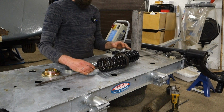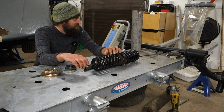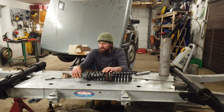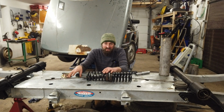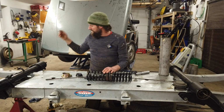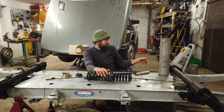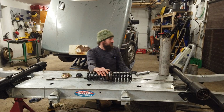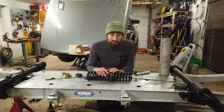I really like it. And the first time I saw it, I got a bit scared about these push rods because they are rather thin and they are suspending the entire car. Of course, only one wheel at a time, but anyway, if one of these snaps, the car will just collapse on that side completely. It will just swing the axle up. In the front it got an emergency stop. It doesn't do that in the back. So in the back it will just be able to swing all the way up until the chassis meets the ground. And remember, there's plastic bits and all that up here, so it will not be a very fun experience.